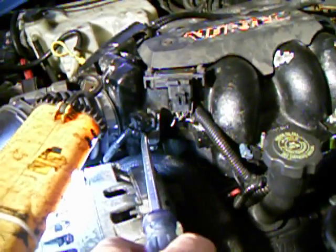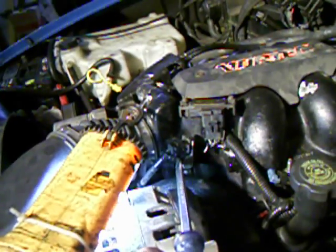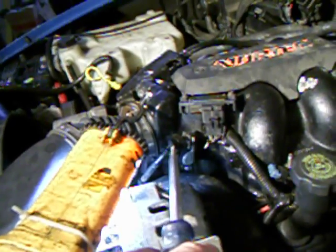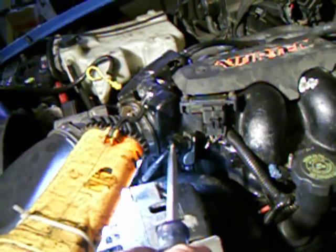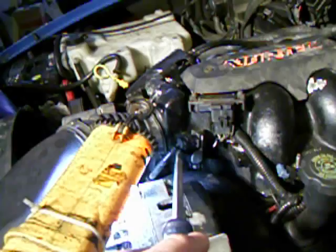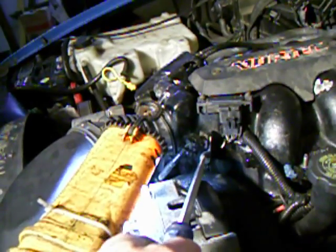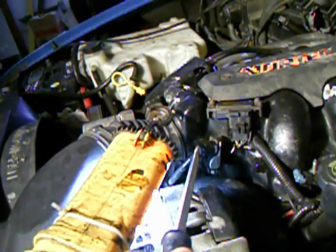Next is the throttle position sensor, and this sensor has three wires in it. By the way, whenever I talk about sensors or anything that needs to have a spec for testing, I've tried to write it up in the description of the video, so if you're going through and you wonder what the resistance or voltage should be, just check those comments. So this throttle position sensor has three wires on the connector: 5 volts is applied to one of the wires, one of the wires is a common to the ECM, and the third wire is a signal wire. The ECM applies 5 volts across the variable resistor — it's a potentiometer — and as the throttle is moved, that potentiometer swings to indicate a different resistance, causing a different voltage drop across the two terminals, and then the ECM can know what position the throttle is in.